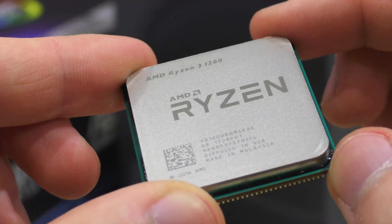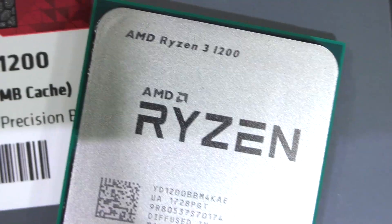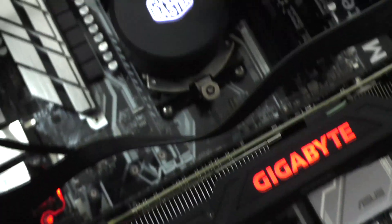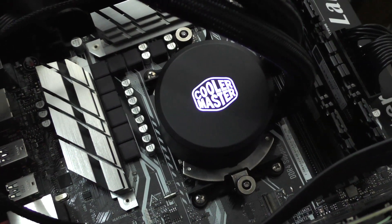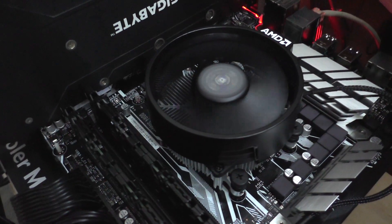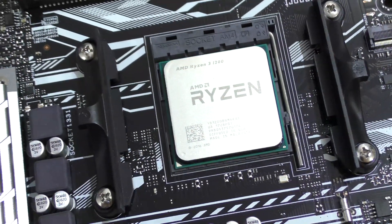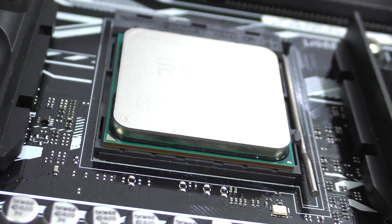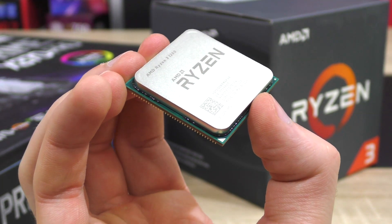The rendering performance is actually pretty good at $120, but of course not mind-blowing. Someone looking for a CPU to do lots of video editing and rendering — this is the wrong CPU for you. The power consumption is super low, and same goes for temperatures: 34 degrees with liquid cooling and 48 degrees max with the included stock cooler. At this point I have to say, it makes absolutely no sense leaving this Ryzen 3 at stock clocks. It's pretty much begging to be overclocked — once you do, even with the stock cooler, you're going to see some fine improvements, transforming this 1200 into a real inexpensive beast of a quad-core.